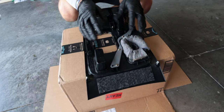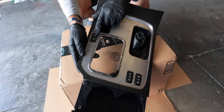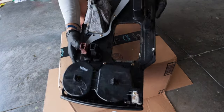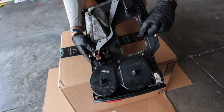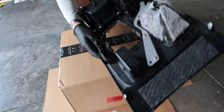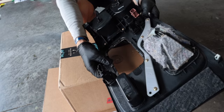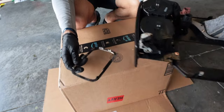Before we get to painting and sanding and all that fun stuff, we need to remove these pieces and this one as well. I'm going to try to remove this because it kind of shifts around, which is not going to be good for painting, and then we'll have to tape this off. If you guys look at the tabs in there, you want to move it up and then over to where you can push those tabs out and get this piece out. As always with plastic pieces, you want to be a little careful.